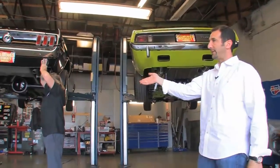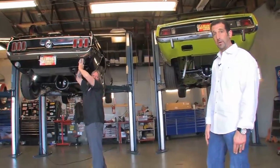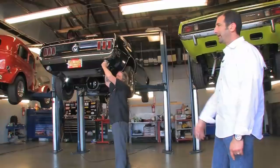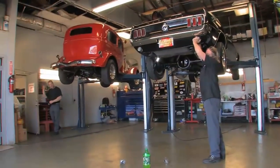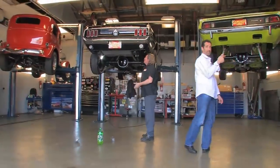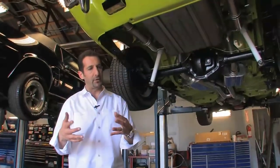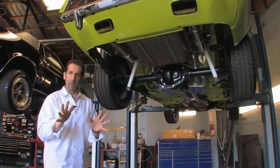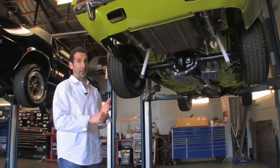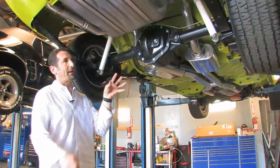Here's the lift. This is who we call Diamond Dave — Dave is a world-renowned engine detailer, and he is spectacularly handsome. He used to be a supermodel, decided that was not for him. Cliff over there is our Master Mechanic — say hi, Cliff. A couple of the other guys aren't here today; it's a Saturday. I wanted to walk you underneath this Cuda. When doing a Hemi Cuda, a lot of people do clones and shortcut. Things that are absolutely paramount, especially with a four-speed, are the Hemi four-speed transmission — this is the big Hemi four-speed 18-spline trans. Got to have the Dana with a four-speed; it came from the factory that way.